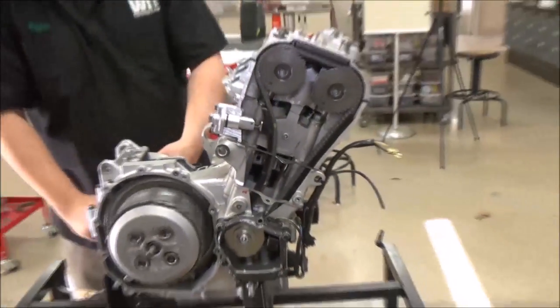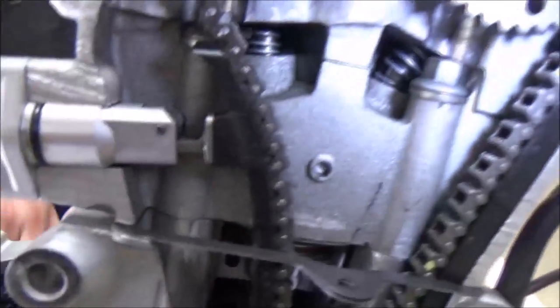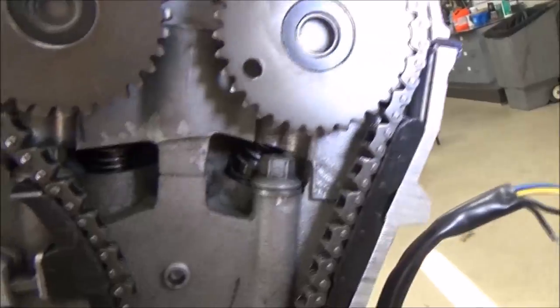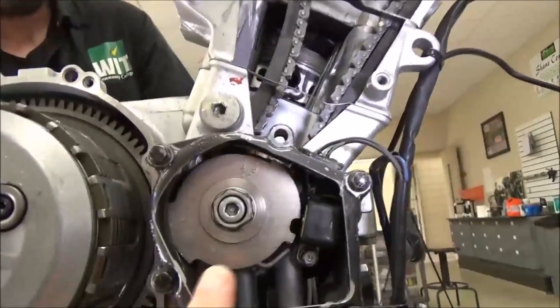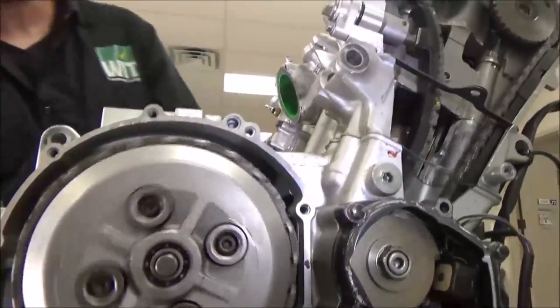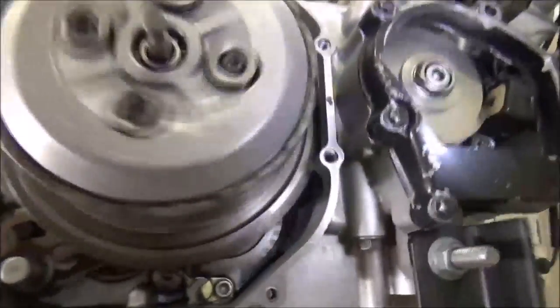The students put a lot of hard work into all the time in this with some guidance here. I can do cam timing, cam chain. You can see the cutaway of the cam chain tensioner. You can see the valves opening and closing inside there, and the piston going up and down. So they really get to see all elements of this. We can do timing. We got our clutch basket here. One of the future things to do is I've got the cover cut up to where I'm going to be able to have an arm on there where we can watch the clutch engage and disengage.